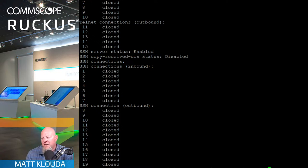Walter, you know what I would do? Honestly, man, I don't run switch code personally. I'm not a fan of it. And the only reason I'm not a fan of it is because I come from more of a routing background than a switching background. Running router code in an ICX is mostly beneficial because you can do so much more. You can create VE interfaces, which are VLAN interfaces for your VLANs. You can enable things like routing protocols, OSPF, BGP, ISIS if you wanted to, RIP if you really needed to, access lists, things like that. It gets you so much more functionality in the device by just running a separate software type. That's really it. So I would recommend router code at all times.